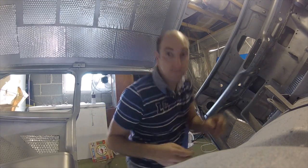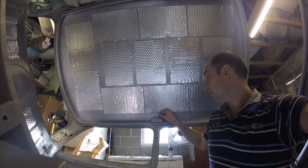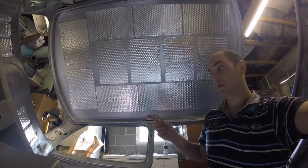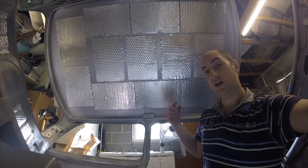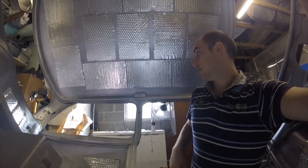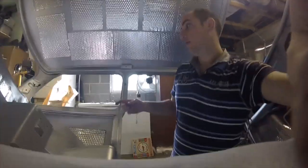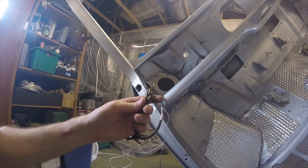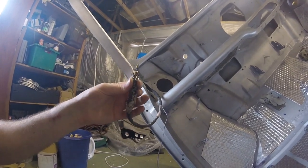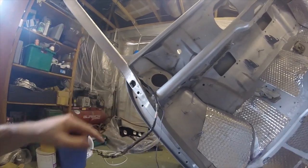You can see purple and white - here's the purple and white one here. This is the live feed, but unless it's earthed, obviously the lights don't come on. So you need one of the two switches to be active to earth. We've got basically this bundle of connectors which join the looms - that's all your lights pretty much.